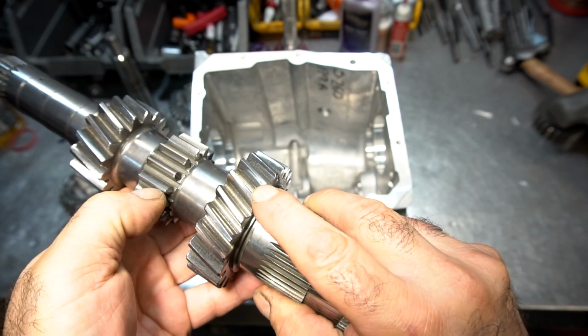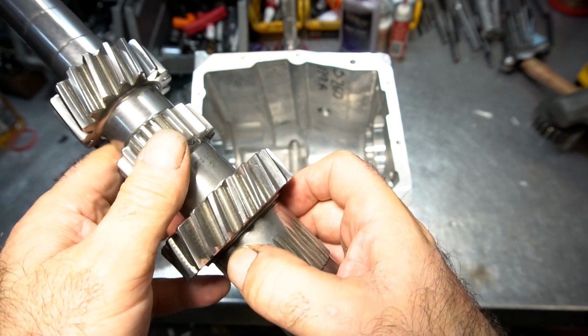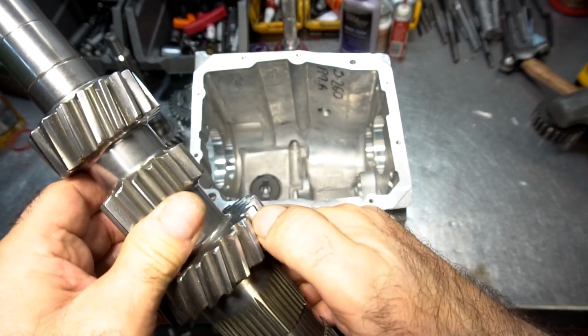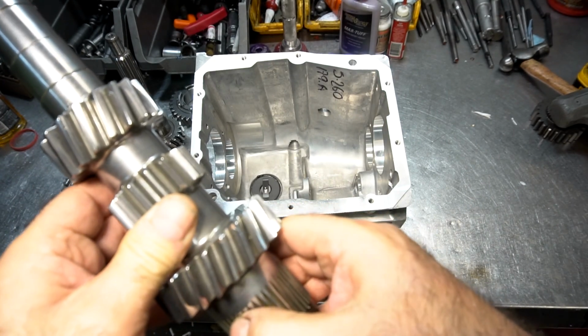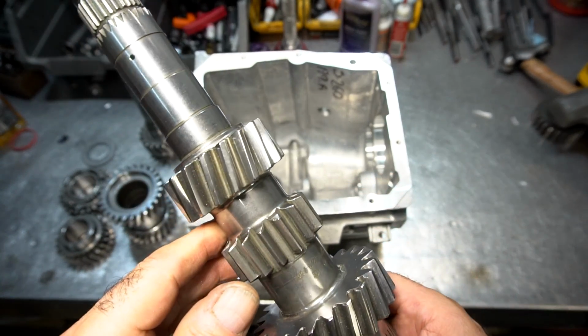So these gears are going to have to be deburred before I put them in the box. Look at this one. You see this raised edge on it? So they do all this nice polishing work, but they never actually deburr the gears. And so I call it sloppy material handling. Here you can see this nice raised portion over here on this tooth where they just simply overlook it. They probably throw the gear in a pile, let it bang against another gear, and then they all need to be cleaned up. So part of the problem is that you'll go out and spend $1,500 on a brand new high-performance gear set, and the people who are manufacturing it just bang the gears against one another and throw it in the box. So even though these gears are expensive and they look pretty, you still have to go over every gear and deburr them. It's very critical in putting together a performance transmission.